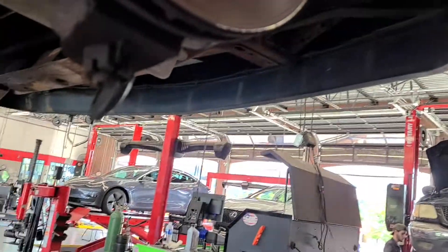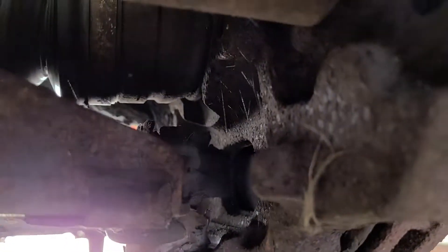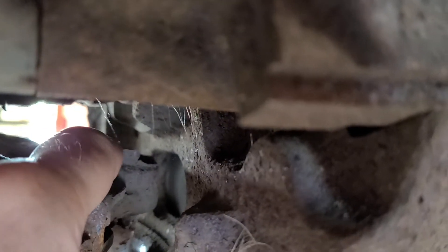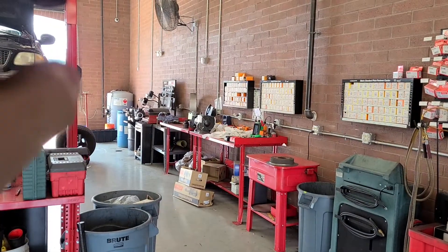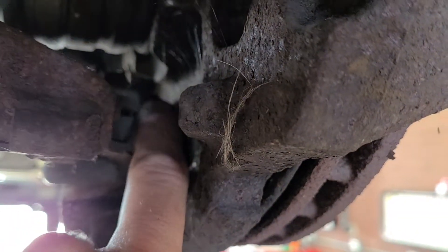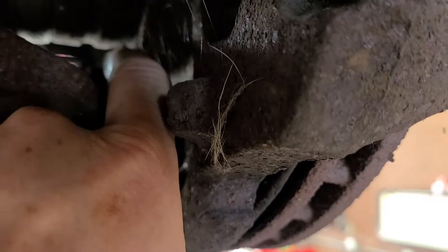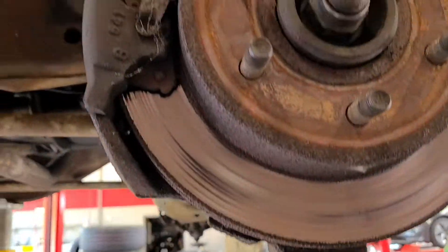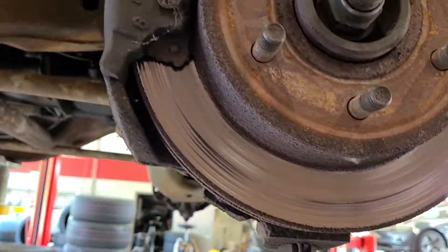If that fails on you, you're going to go down. Matter of fact, look right there — you see the very top? That little piece was the top plate for this ball joint assembly and it is busted out. There's a metal stud that comes through here, attached to a ball that sits in a socket up there — that ball part is busted out the top. So yeah, the other one is absolutely trashed. Of course the front brakes on this are trashed too.